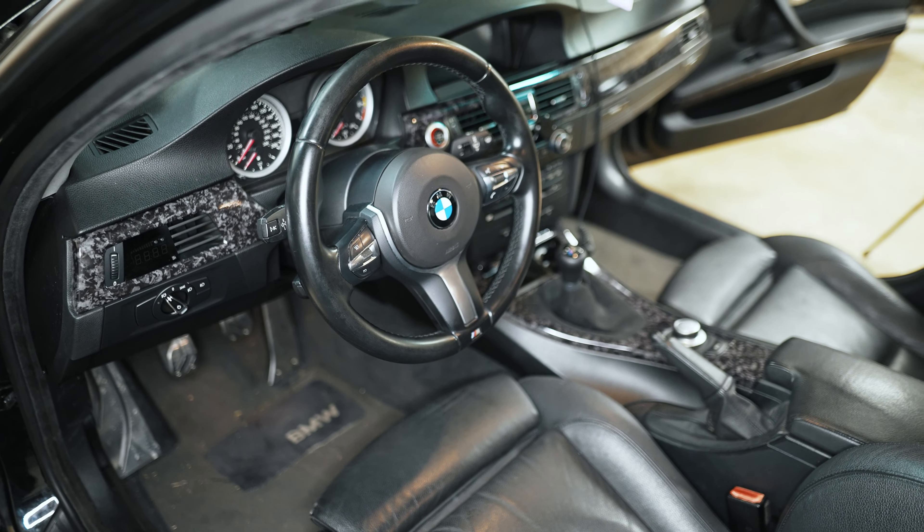The rack is still hydraulic, so you maintain feel as speeds increase. One of the last features active front steering offers is compensation for uneven roads — if the car is tilted and you brake hard on a wet surface causing it to pull to one side, the active servo motor driving the planetary gears in the steering rack will counter-steer, giving you a steady brake feel even without DSC intervention.